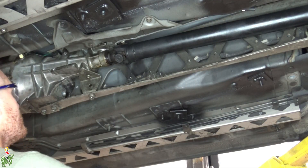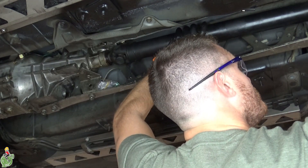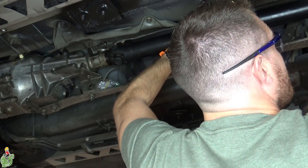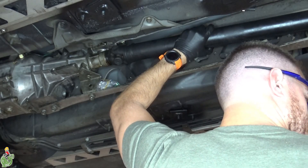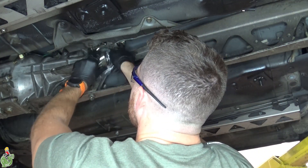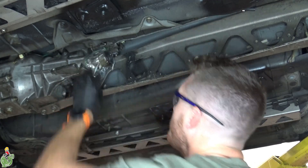I'm stashing a little plastic bag with some rubber bands up here in case when I pull the driveshaft a lot of transmission fluid comes out — FYI I have not drained my transmission fluid here. I'm removing the one remaining driveshaft bolt with my right hand and then I'm going to pull out the driveshaft with both hands after that's removed. Wrap this up just like the shifter turret above and hopefully you won't lose a lot of expensive transmission fluid.